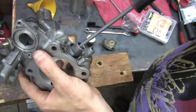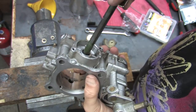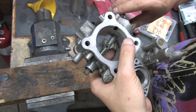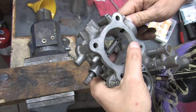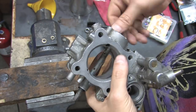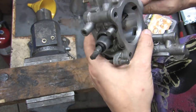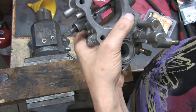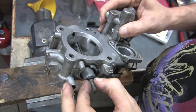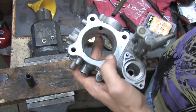The big difference shows up when you try to install the throttle shaft. You install the 2G shaft from the TPS side, just like with the 91 to 94, but the throttle shaft is cut differently, and the loose seal on the linkage side just pushes right out no matter how carefully you turn the shaft and try to work it through. The 9mm step on the shaft, along with the grease, just pushes this thing right out. Normally this isn't a problem because the plastic spring separator is bolted up flush with it, preventing it from getting blown out by boost, but when you're putting this thing back together, it can be a real pain.